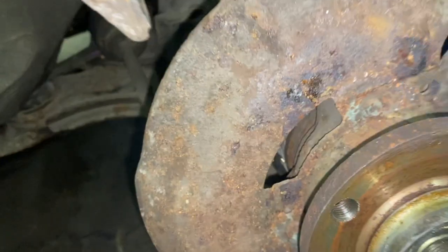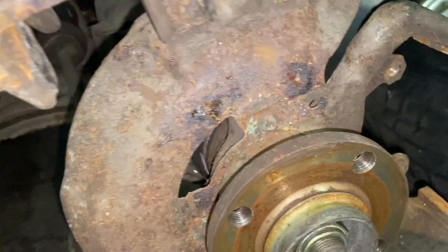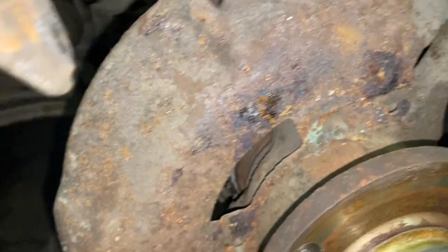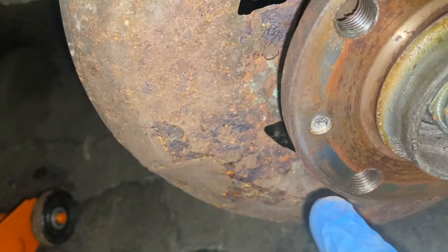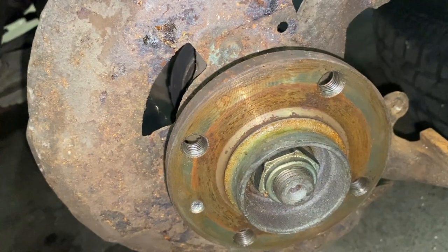And then I'm going to take this off. I'm going to give that a quick spray with some black paint just to stop it rusting anymore, because it's not through, but it doesn't look very pretty. And you can see there's copper grease everywhere here. So then we'll be copper greasing up, get this out as well, because I've got the new screws for that as well, and then we can put the whole thing back together.